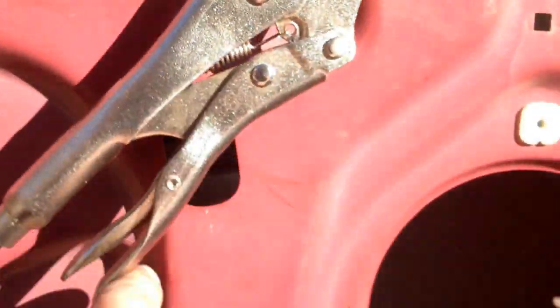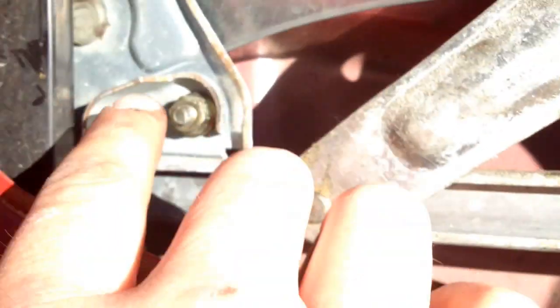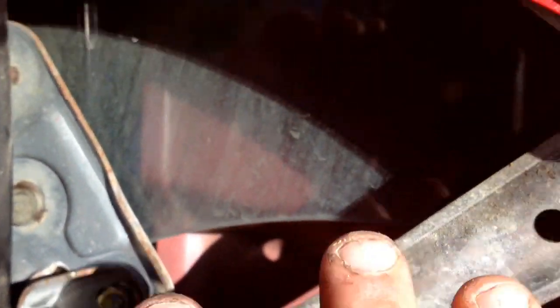So if you have this one in this spot, where you can see the bolt perfectly. Sorry for the sunlight, it doesn't want to focus either. So if you have that bolt there, you can immediately get this one as well. And then you can take the window and pull it up. Make sure, because this is a stud and it has a nut, you pull this off, same thing, and then you pull the window up.